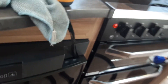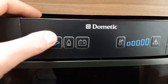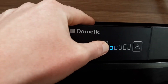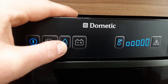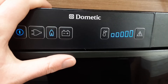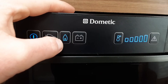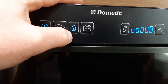You can then go to your fridge to operate the fridge system — very simple to do. The first symbol you're going to see lit up is your 240 volt coming into the caravan from the caravan site. When you're on 240 volt, you can control the fridge temperature with the button on the right-hand side — the higher you go with these blocks, the colder the fridge will be. Press the gas option next and the fridge will self-ignite on gas if you have a gas bottle connected. If it fails to ignite, it will flash the red warning triangle on the right-hand side. On gas, you can use the button to control the fridge temperature. If the gas light is solid blue, as it is at the moment, it means it has ignited and is working as it should.